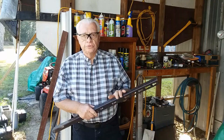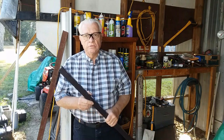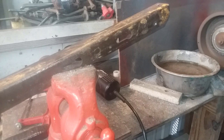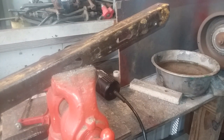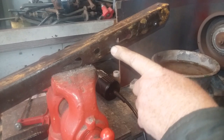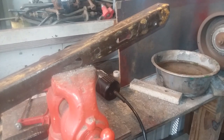Bed rail is very difficult to drill usually — you hear complaints all the time: how do I drill bed rail? This is a technique I use that I'm going to show you today. If you have difficulties drilling through bed rail, try this. You can see this piece of bed rail here with several holes in it — some factory, some I've been drilling myself. If you're having particular difficulty, see if you can get yourself a pilot hole, even something as small as that little one-eighth-inch hole right there. If you can go bigger with a regular drill bit, that's fine.